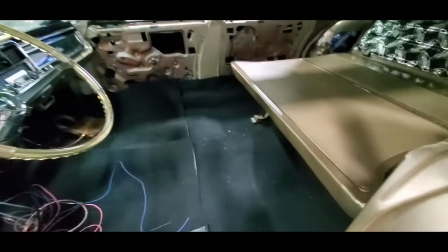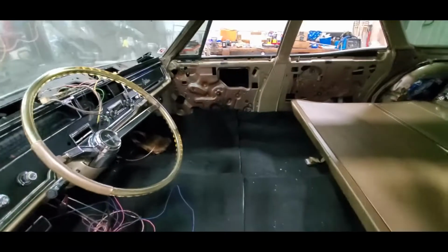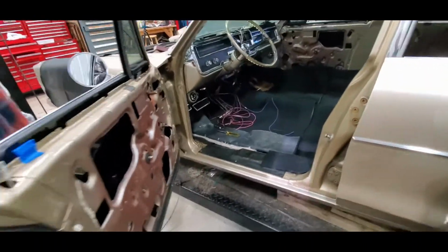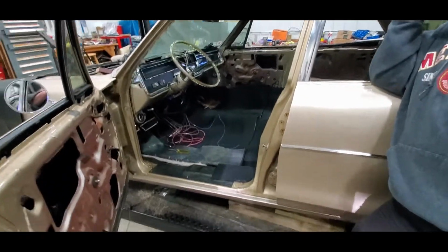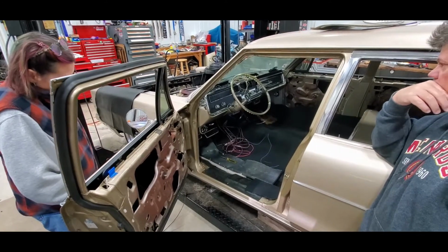And for holes like the seatbelt holes, which you'll note, like one's right here, the bolt is still there. When we actually lay the carpet for real, all the bolts will be out. You lift the car up, you climb under it, you look for the hole, and you poke the hot screwdriver through. And that locates them positively instead of guessing. So now I'm going to see what their reactions to all this are.